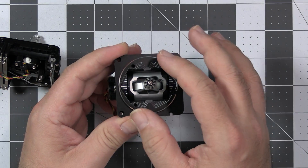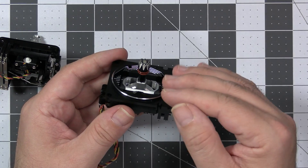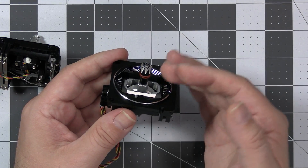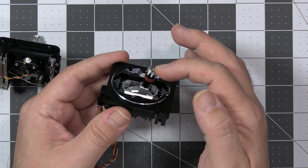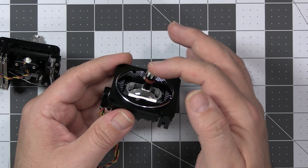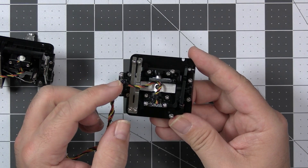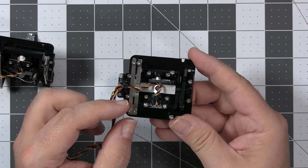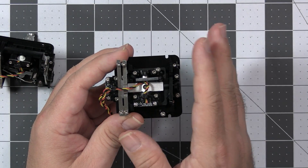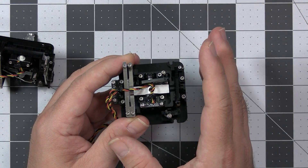You can also adjust the feeling in the center — not only the total tension and spring preload, but also how the gimbal behaves in the middle and how strong the stop in the middle is. The throttle ratchet and tension springs are accessible from the outside, though this is not something you want to adjust continuously when in the field.